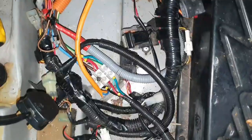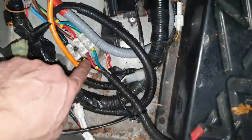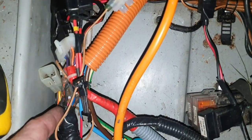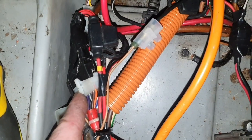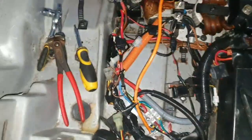So here's our progress. I've basically just wired all of this up here - the charger, because this charger was originally not plugged in, so I've wired that up to the mains. And I've just over here put in that little modification that goes onto the charger, and that will charge up to 66.5 volts. That's all fixed. I've got the batteries all in. I'm thinking of putting the next layer on the top of here so that I've got the extra range.